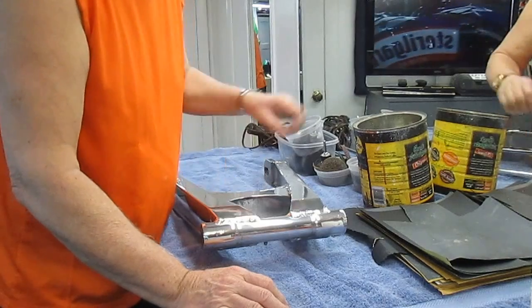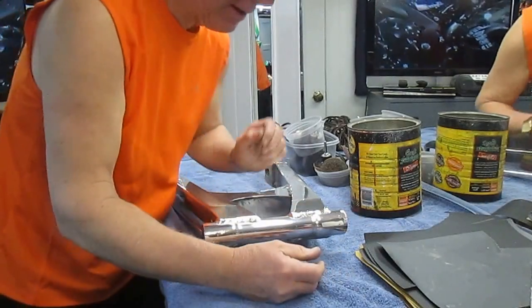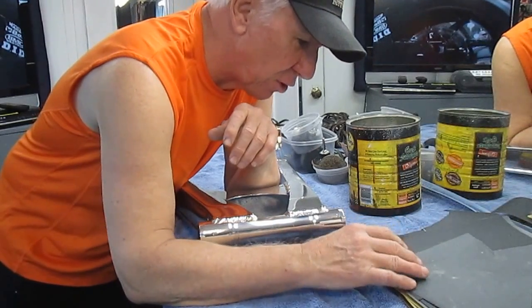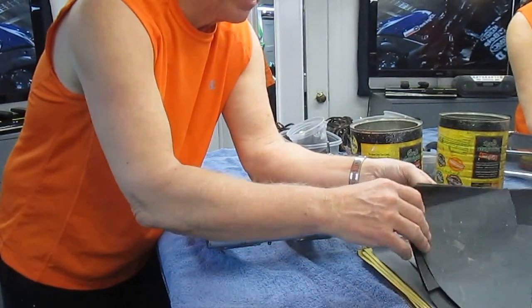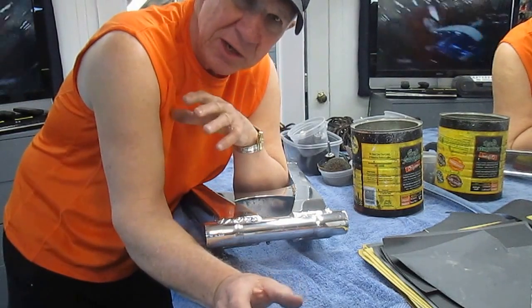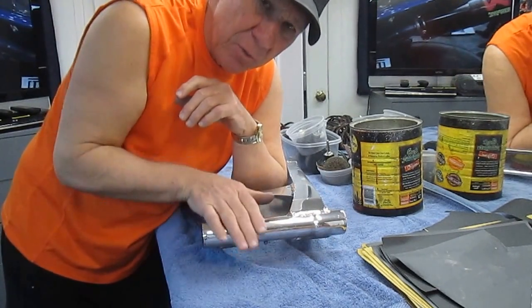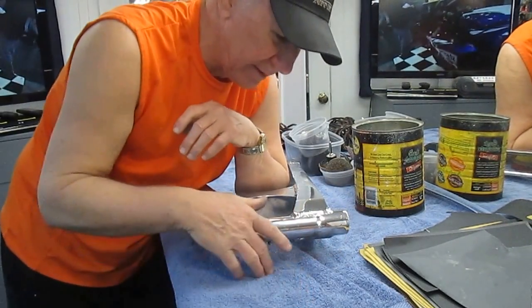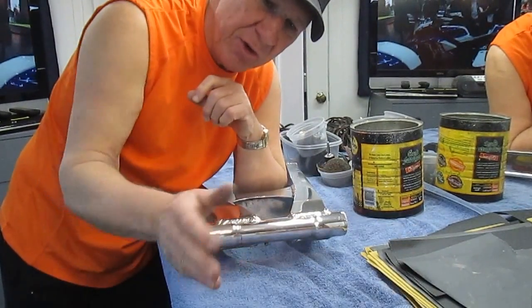In this case I found a little trick. I went to a part you wouldn't really see and started with 220 grit sandpaper. When you talk about polishing, you're talking about getting rid of scratches, and the 220 puts a lot of scratches in but takes a lot of material off. If you get all the scratches going in one direction and then go 90 degrees, it makes the next step a little easier — not totally easy, but better.